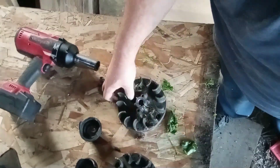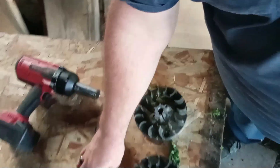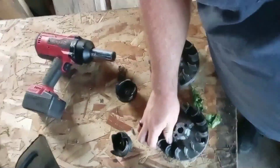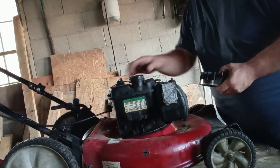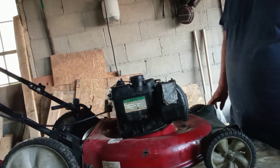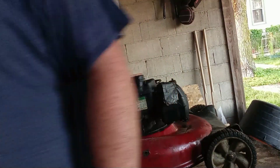The magnets just hit. There's the flywheel that came off of it. There's the one off the parts mower - they're identical. I am going to change the nut, starter cup, everything. And as you can see, the key is still in there. Let's get set back up over there and get back in here. I'm gonna take our flywheel, probably gonna take some of this grass out of here. Little broken chunks of flywheel. I probably ought to find something to tie that flywheel brake back to make it easier to put the flywheel on there.